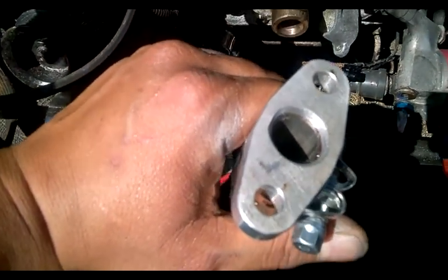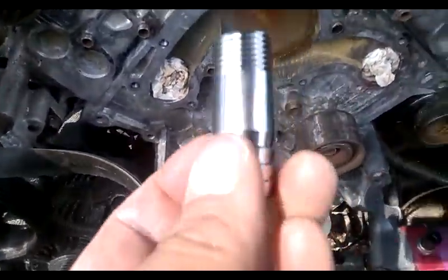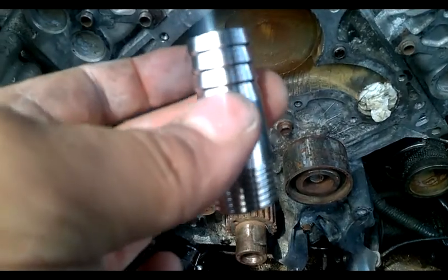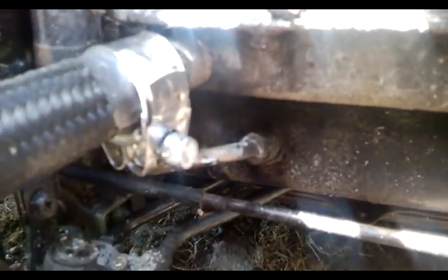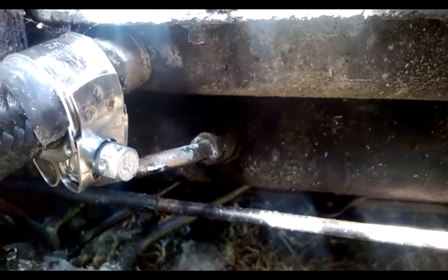I've cut the original AN12 fitting off and tapped it with a half-inch BSP tap, with some thread seal to accommodate the hose from the turbo. These adapters are really, really good — cheap and easy to put in; I think this one was only about a pound or so. Same again, it goes down and I've actually drilled into the sump and tapped it, putting the same fitting in that hole.